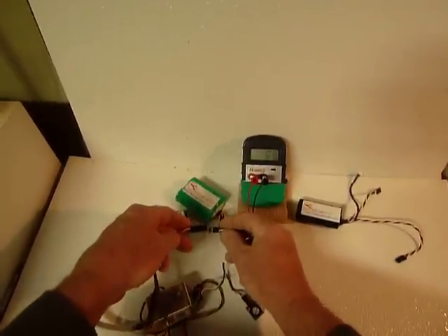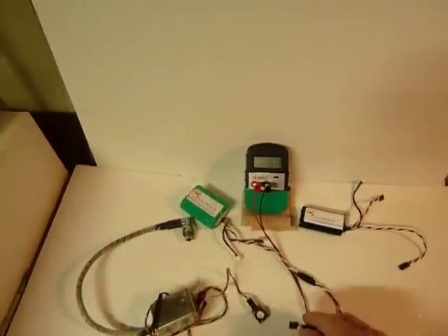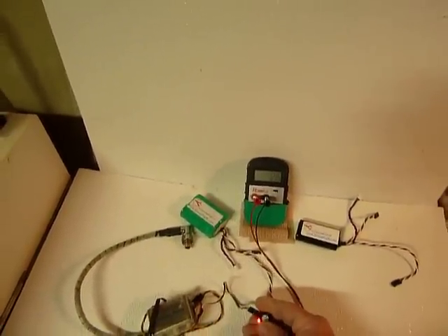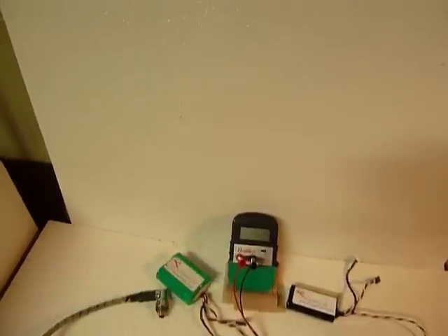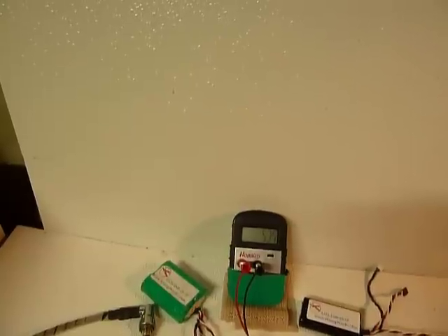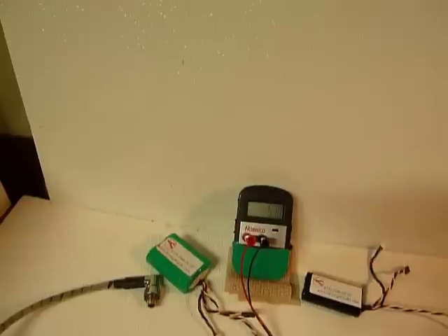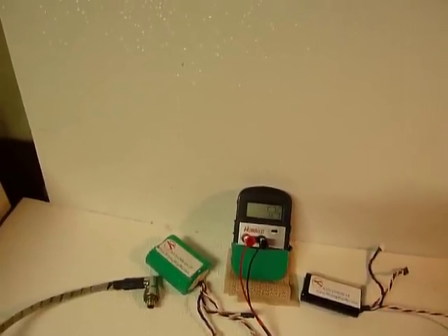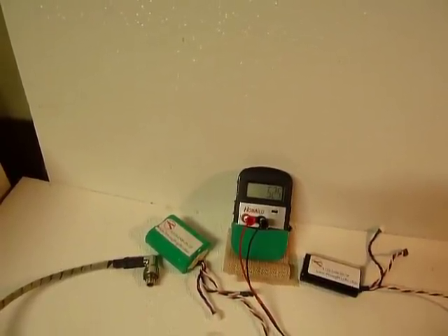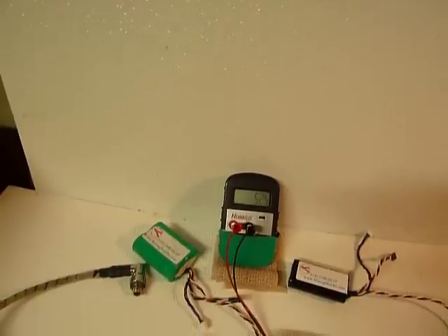Here goes the inline diode plugging into the 2300, now plugging into the ignition. At a thousand RPM idle, you can hear the spark plug sparking — we're seeing 5.4 volts. At 3,000 RPM, 5.3 volts. At 8,000 RPM, 5.3 volts. Take it off the chart to 15,000 RPM — not too many gas engines will see that — we're still looking at 5.25 volts. So with the twin diode voltage reducer, that's a nice voltage.